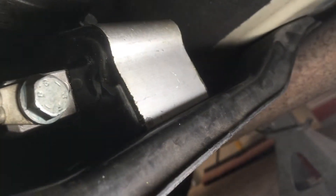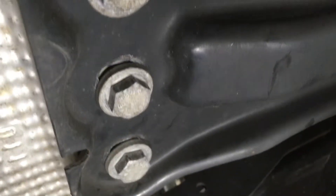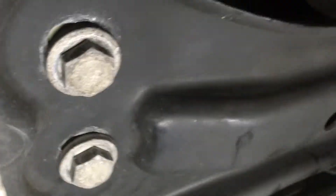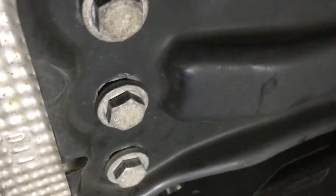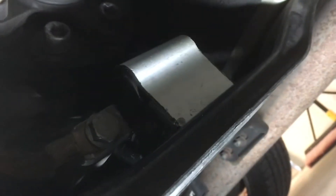You can see that new one is in there — it's all solid on the sides. I did have to adjust my chassis bracket just a little bit, so I had to undo those bolts and slide it forward a bit just to align the bottom bolts. Those are also 50 newton meters if you have to adjust, and they're the same 16 millimeter size as the upper bolts. That's it for the install.